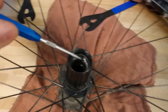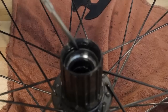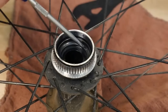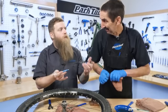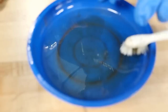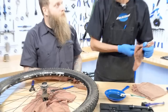Here is another old trick: trace the ball path with a pin. You're going to trace where the ball bearings roll, and if there's bumps or roughness — much like a chuckhole in the road — the ball bearings are like car wheels, and if they come across a pit it's going to make a rough ride. I don't feel any pits here. So inside the hub, you can see the cup — the surface that the bearings sit in — and it's the other half of the cup and cone system. Everything feels pretty good on the drive side. Flip it over and have a look on the non-drive side — everything looks good. The surfaces are smooth. So what was that roughness we felt? Most likely it was grit — you can see a little bit of grit. And it was possibly a little mal-adjusted, a little over tight.